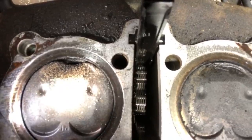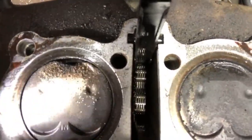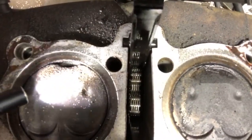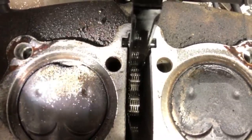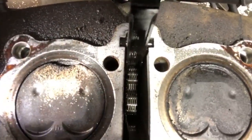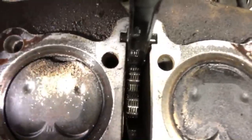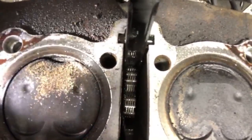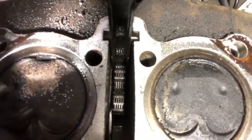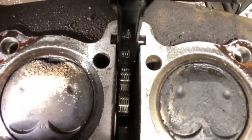Because detonation usually happens where the spark plug is. So I don't think it's detonation, but someone said something about a valve. Pete, that's what I'm thinking as well. When parts of the piston get weak, they can get red hot, right? Red hot, and start to erode away.